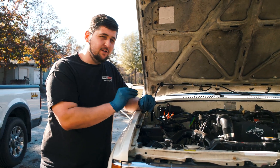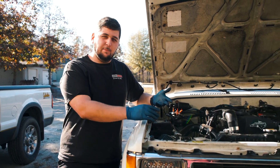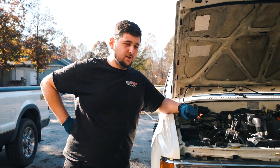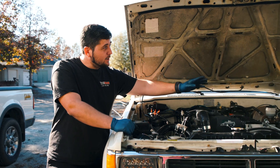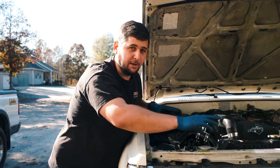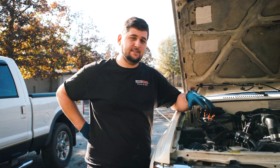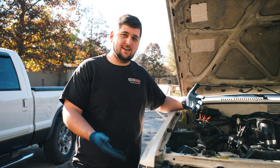I had very little piping work to do. The only downside is that if you put it in the front and fabricate that, you'll probably get a little better airflow and may see a power gain — but that's mainly for you power guys out there. This truck is only tuned to a hundred horsepower; I was trying to leave it stock, just want a daily driver. The only downside I ran into, which really isn't that bad, is a little rub right here on the hood, which I fixed by just adjusting the hood slightly. This was super easy compared to running intercooler piping into the front and cutting up behind the grill. I also plan on adding AC, so I wanted to make sure I still had room for a condenser — and I didn't want the intercooler to be noticeable from the front end.